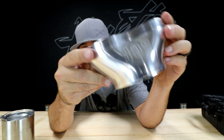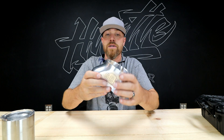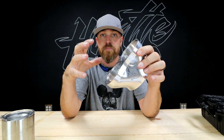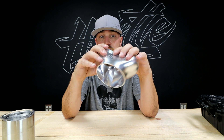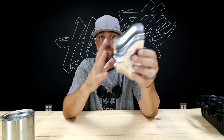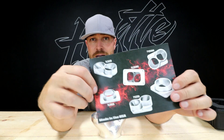How rad is that thing — both sides. Whether you're doing an exhaust system or an induction system and you want some really nice transitions, this is the way to go. What I've always found working on stuff is that doing a transition from the same size tubing isn't too difficult — like dual threes to one three-inch, that's not that hard. But when you start mixing it up, going from dual three-and-a-half to five inch, it gets tougher, and that big tubing takes a ton of space. So this piece can fix that problem as well.